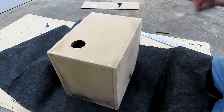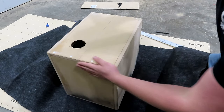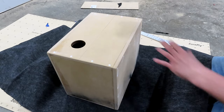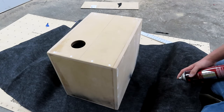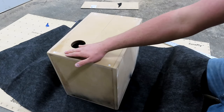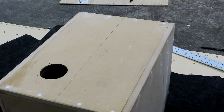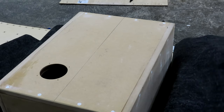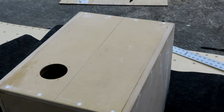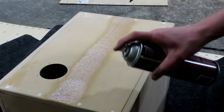Now start laying on the spray glue — shake it up pretty good, more the better. It's important to note that I've sanded all my edges down and rolled all my corners — everything is super smooth. I did that before painting the port; get everything nice and ready for a nice coat of carpet. When spraying the box, only spray the side you're actually going to carpet. Keep the fabric face down the whole time — you don't want overspray on the nice pretty outside of the carpet. Keep it pulled out of the way the whole time.